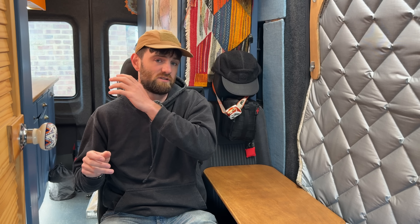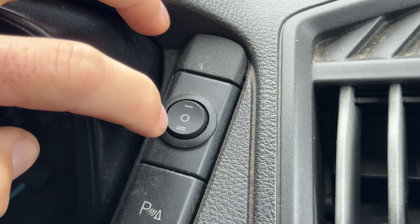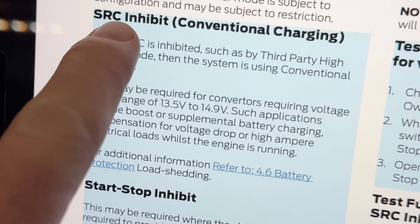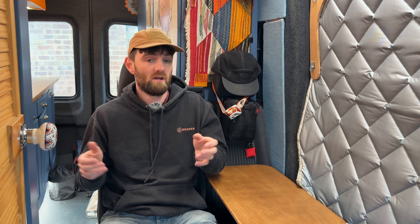For me, that's a problem. I have DC-DC chargers running to charge my leisure system in the back of the van. When the alternator output is turned off by the vehicle's ECU — because it thinks it doesn't need to be on anymore — even though my DC-DC chargers are running and have a signal telling them to run, they're not actually working anywhere near full because there's no alternator output. One of the reasons in the manual for the smart inhibitor is for customer high output mode, for customers who need high DC outputs whilst driving, which smart regenerative charging would interfere with.